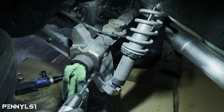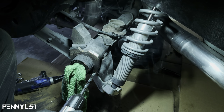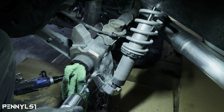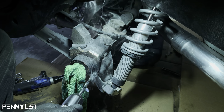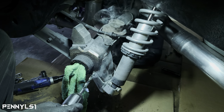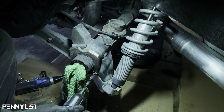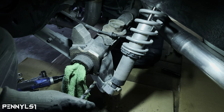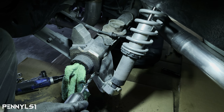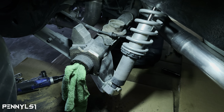Ooh, my glove hot. Only thing, this drill bit is round on the chuck side. It ain't got a flat spot, so it's not spinning. Almost home. We almost home. Come on. Oh, there we go. All right, so 5/16 first pass, then 3/8.